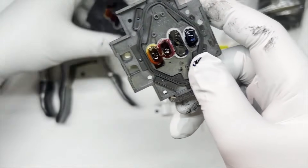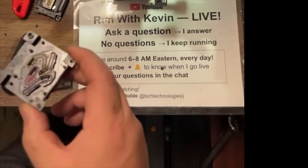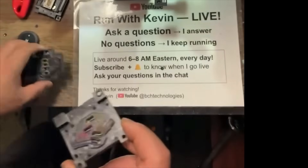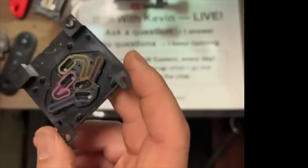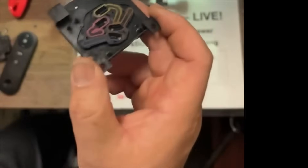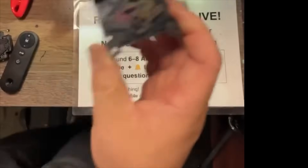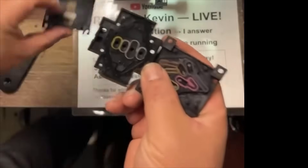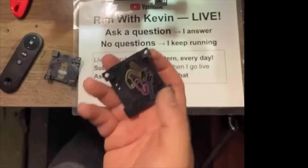Now it's the moment of truth. Inside it should look oval. If you open it up and the inside looks like a maze — like this — that's bad news. The bad news is this video is not for you. The worst news is I did not make a kit for this kind of print head. The good news is you got a really rare F040. I've done about 4,000 F040 print heads and this is the only one I found. I don't want to make a kit for this really rare one. Just a warning: there is a possibility that you open up your print head and you will never be able to put it back.